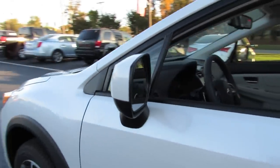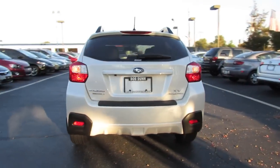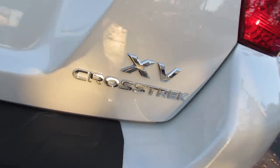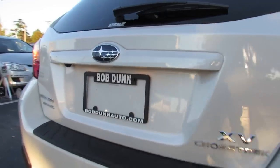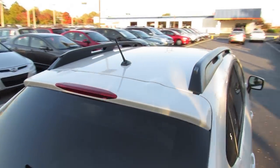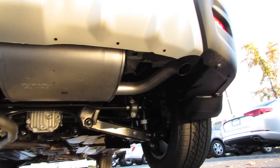You can also attribute this size and crossover style to the Nissan Juke and the Mini Cooper Countryman, though those two vehicles have a sportier, more performance-oriented driving style but don't have quite as much practicality and interior space. Subaru's symmetrical all-wheel drive is standard on the Crosstrek but differs between the CVT and manual. With the CVT, it features an electronically controlled multi-plate clutch with 60-40 front-to-rear torque split. Manuals have a bevel gear center differential with viscous coupling limited-slip differential and a 50-50 torque split. The rear of the Crosstrek is accented by a rear diffuser-style clip with a recessed exhaust for a clean, smooth look.